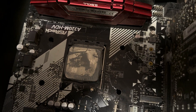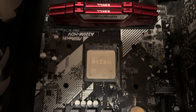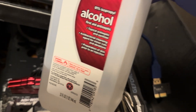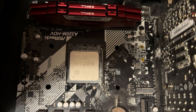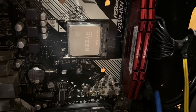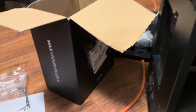Now we're going to go ahead and clean this up and get it clean. I took some jumbo cotton balls and some rubbing alcohol — the higher the percentage the better — and just rubbed this off. As you can see it's a lot cleaner now; you can actually read the information on the CPU. You've got to make sure all that thermal paste is removed before you proceed.